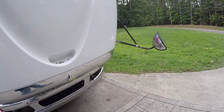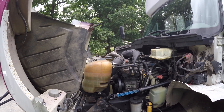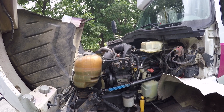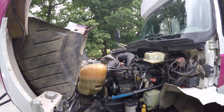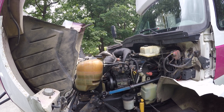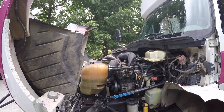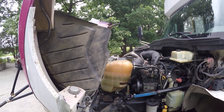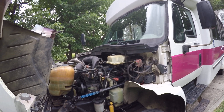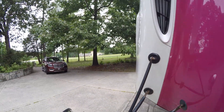You could go further on oil changes — 5,000 miles on these engines. Unless you're doing something super special, just driving down the highway maybe you're getting 10,000, but I wouldn't go past 5,000. All I use is Rotella T6, and I also use ARC oil in the oil. On this one I'm going to run Sinister Extreme Clean in the fuel instead of ARC oil in the fuel — only because of the regen. In the F250 I run ARC oil in both the oil and the fuel.